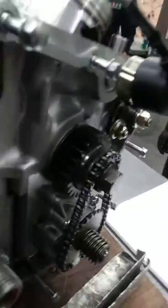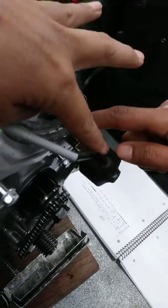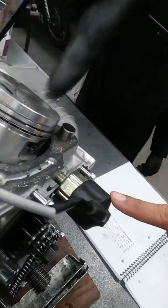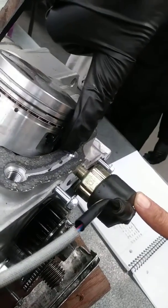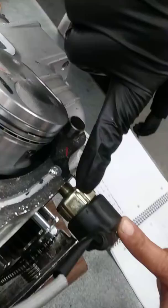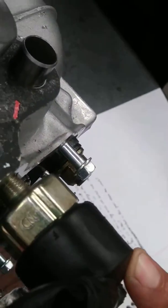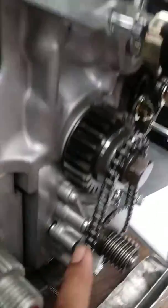This is the oil pressure sensor, and this is a reservoir for the oil. Oil seeps in through here, goes through a tiny pinhole, and into the oil sensor. Then electrically it sends the signal to your gauge, because this is not mechanical — it's electrical.